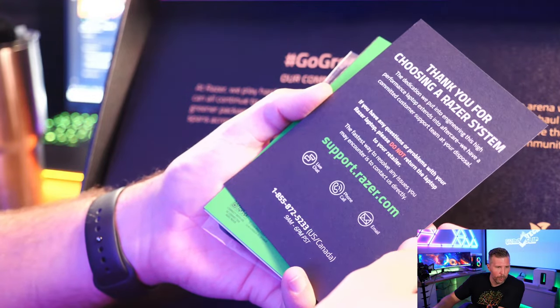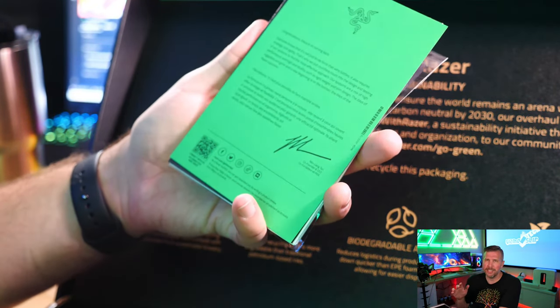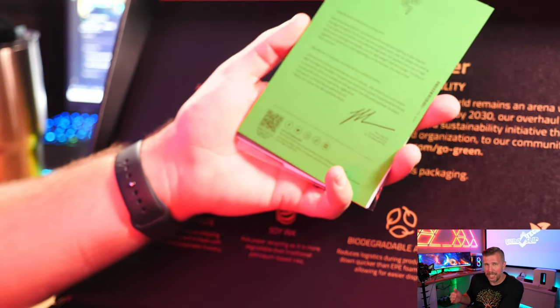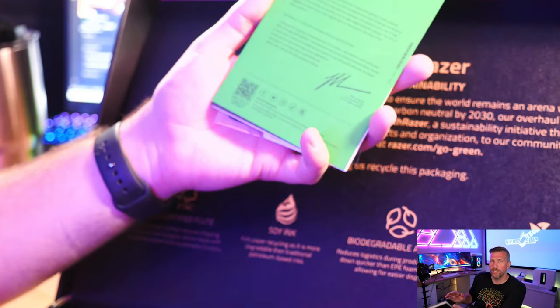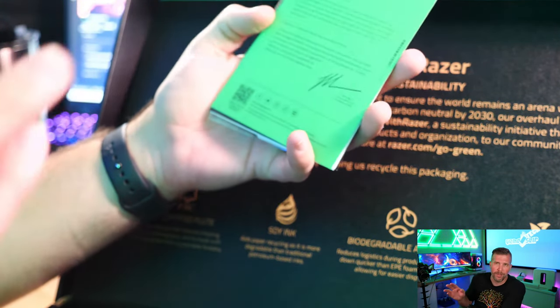So, what wattage is the video card? Great question, Britt Allen. It's a 175 watt. In my testing, though, with the last couple days having it on hand, it was not going to 175 and staying there consistently. It depends. It liked to hover more like 165 to 170-ish in the upper range, and sometimes a little below or above that.